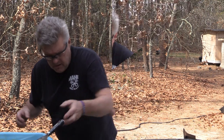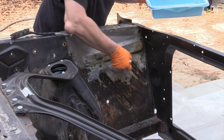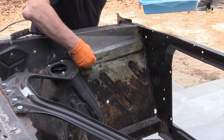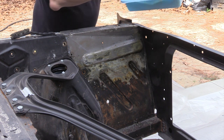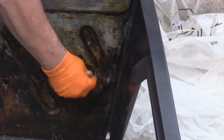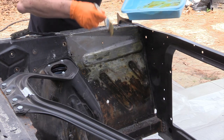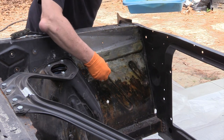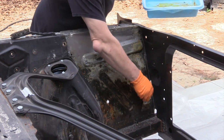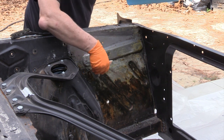We're going to leave that sit for a minute and see if it will cook. These areas I go back in and give them another swipe where I've already peeled the surface back to get down to the other paint that's still fighting back. Then I move to the next section, throw down some more stripper, and I do not go all the way to the edge — I do not want to get the aircraft stripper underneath any of those seams. I'll work to the edge and mechanically remove paint near seams with sandpaper.